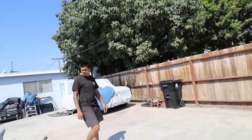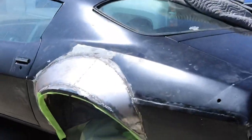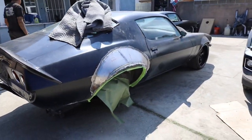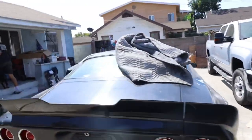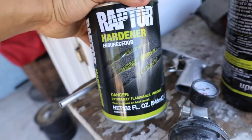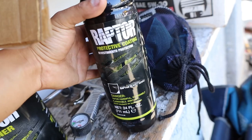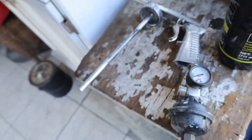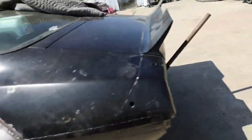Alright players, another day. We pretty much got both flares completely welded, we got the inner skins welded up too, and we got it all masked off. Now we're going to shoot it with the bed liner, same as we did with the front flares. We're using the Raptor hardener and protective coating, this is the gun we're using. We're about to mix those up and then spray the whole inside of the flares.